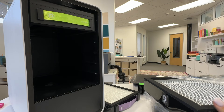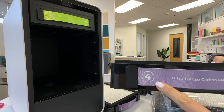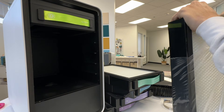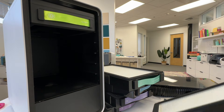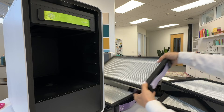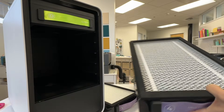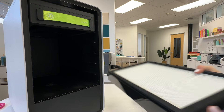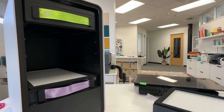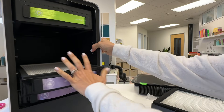I'm not worrying about what order they were in the purifier because they all have numbers on them, so I know where they're going to go. It is important to put them back not only in the correct order but starting at the bottom with number five. You're going to notice if you look closely at these filters that they're all slightly different, so you can see visually. Let's take number five — it's going in this bottom slot. Be careful because this thing is on caster wheels. Five, and then obviously four, building all the way up.